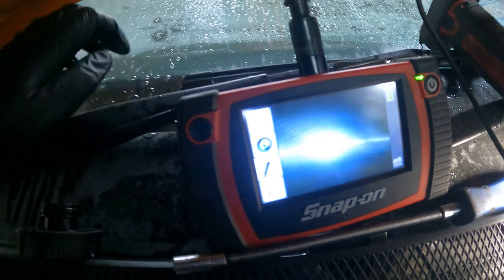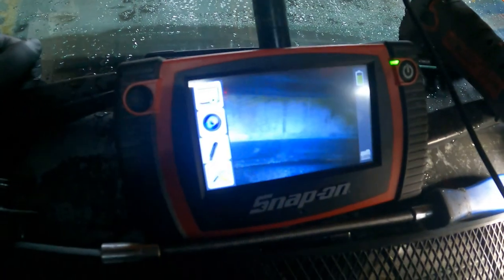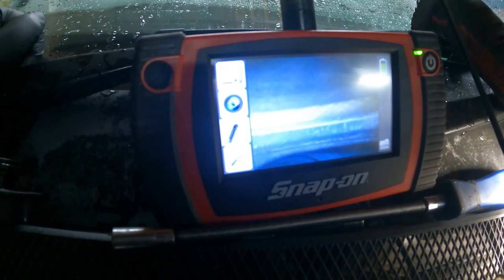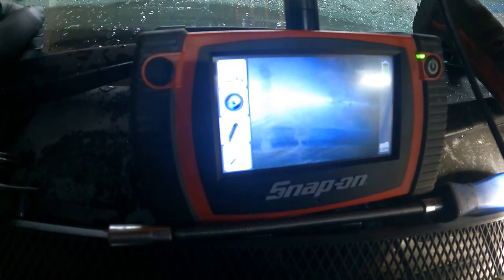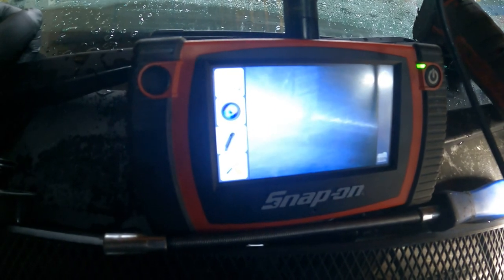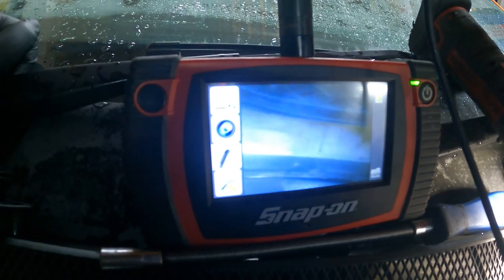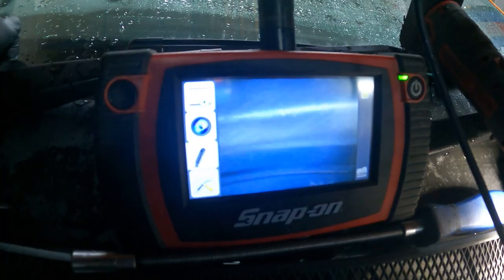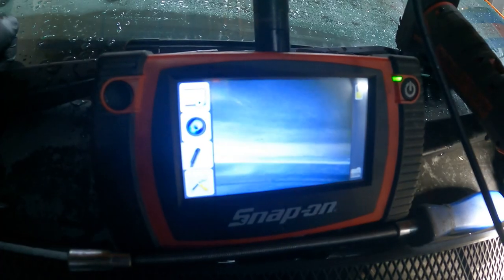We've got something going on — there's a lot of oil in there. Can't really tell what it is, doesn't look like a crack, just looks like a scratch, but there's plenty of oil going on in there. Those are water stains — rust stains on the bores. So there's certainly something going on with cylinder five, which is unusual. I think we could take a chance that it's just generally a head gasket issue. I've just noticed something which backs up a head gasket issue — it's had a pipe replaced.